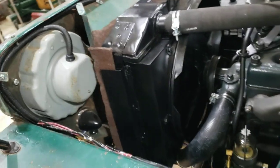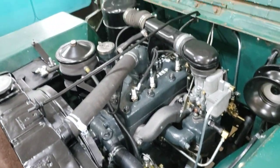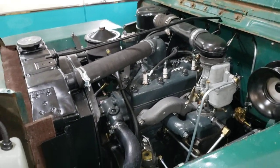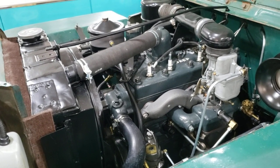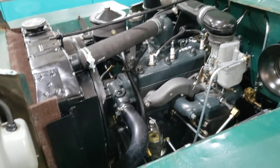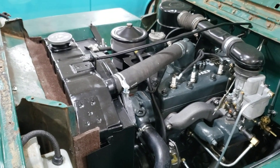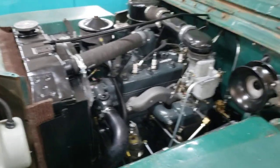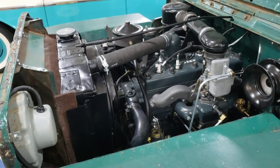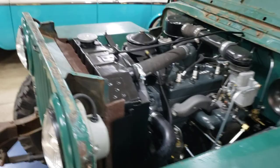Getting a radiator recored, getting that installed. Even just this so-called horsehair felt with these staples — that was most of yesterday. Everything is together, and I decided to go this time, take the path of completely building everything up. I did not rebuild the engine itself — it has not been opened. Had the head off. The carburetor is rebuilt, the fuel pump, the generator, the starter — everything that will unbolt from the engine has been done and freshly tuned up. My thought being, if I make every single thing as right as I know how to make it and properly adjusted, just build up layer by layer of that, then today will eventually come and it should just simply start right up. So let's find out if that's real.